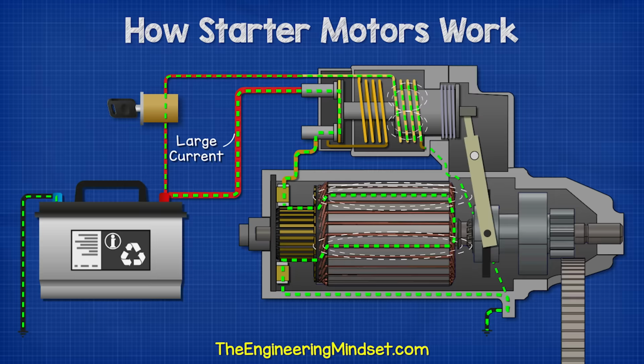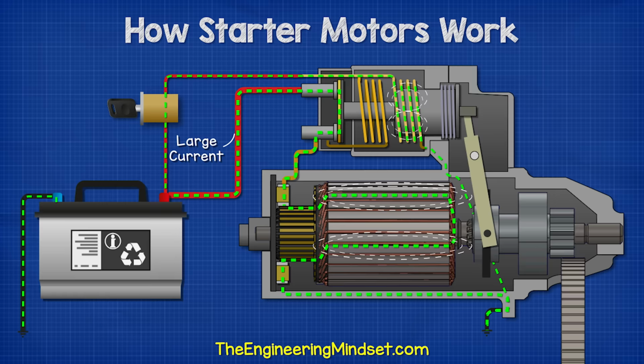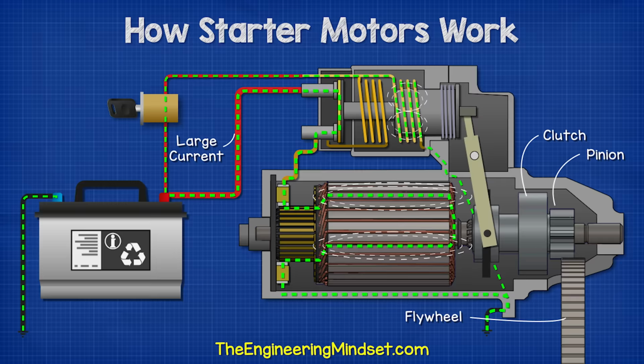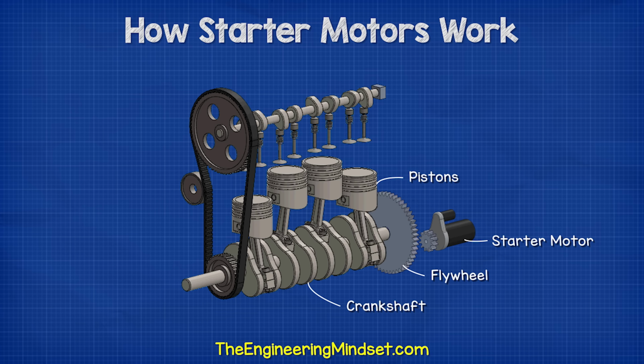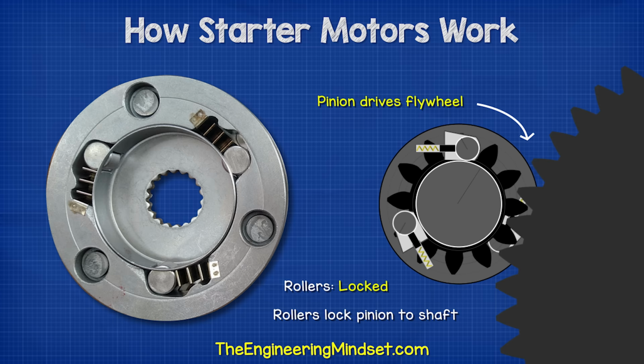The coil produces an electromagnetic field, which interacts with the permanent magnet or field winding in the stator. This interaction causes the rotor or armature to rotate very fast and with a high torque. The rotor transfers this through the shaft, through the clutch, and into the pinion gear, which turns the flywheel. As the flywheel starts the combustion process, the engine will eventually begin to rotate the flywheel faster than the starter motor. This unlocks the overrunning clutch, so the pinion gear spins freely.